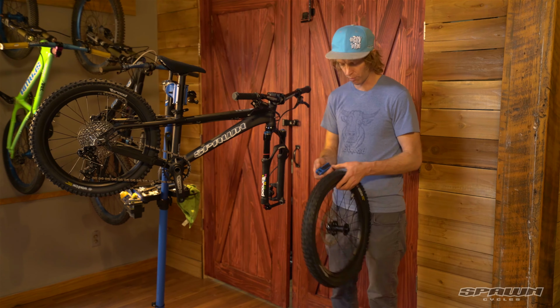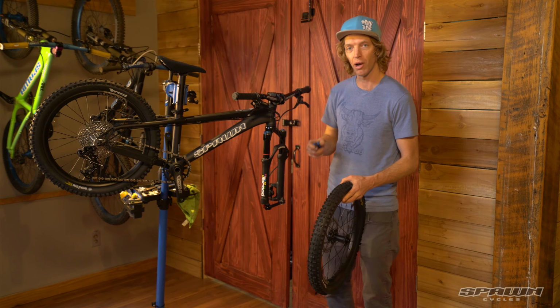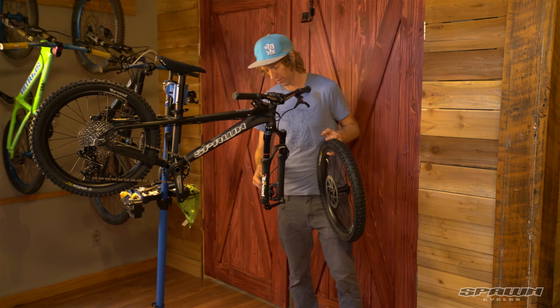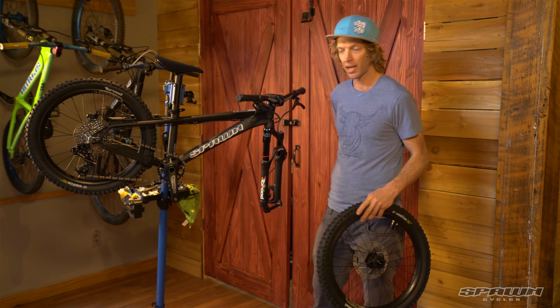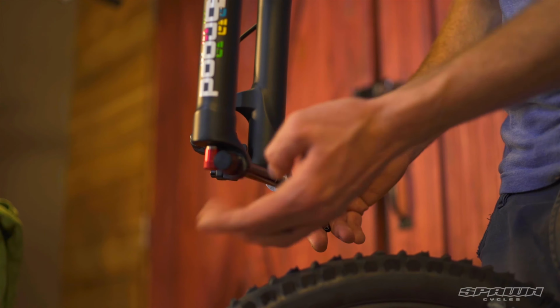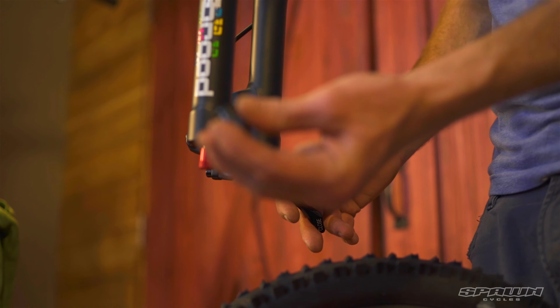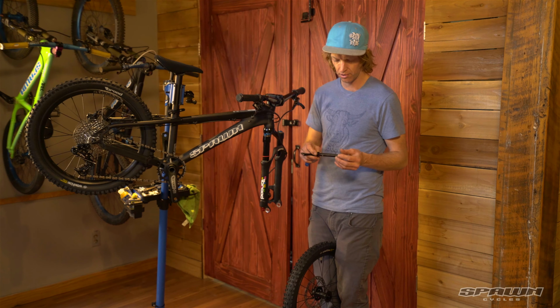Before installing our front wheel, we want to loosen the 5mm mounting bolts on the front caliper, so we have free movement in the caliper. Also make sure you removed your pad spreader. Next we're going to take off the front axle. It's a 2-part axle. It's got a lock nut on one side and then the through axle.